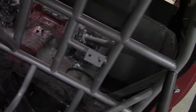As I said in one of the first videos, the plan is just to go between the frame rails here, chop all that off. We'll kind of square it off back towards these plates on the floor, and then we'll box that in, of course, tie it back into the lower bars as they get installed in the floor. And we'll cut all that out back there where the torque boxes will reinforce that, where we had the cage tied into that. And of course the floor itself.